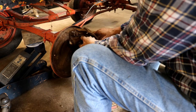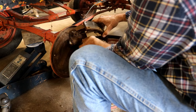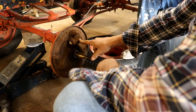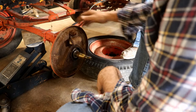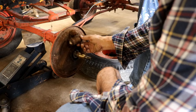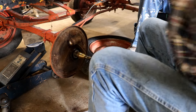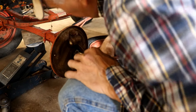These wheel cylinders — or brake cylinders, whatever you want to call them — the cylinders are corroded over and it's going to take a little work to get them uncorroded. All these parts to get to that. There should be two bolts on the back of this, but of course this is going to make it leak fluid. I don't think there's much chance of moving these. I guess it won't hurt to try, but I don't think it's hardly worth trying honestly. I'll give it a shot just in case.